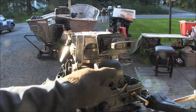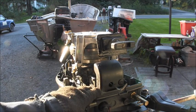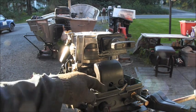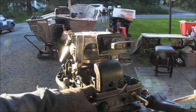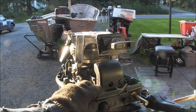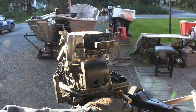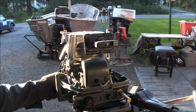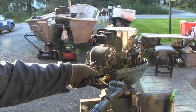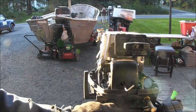But behind these rubber plugs that holds this to the carburetor are two screws. They will typically be Phillips head screws. And taking them out, if you drop them, they're just going to drop down into the bottom of this plastic air cylinder. But when you're going back up with them, a lot of times, if you drop them, they'll drop into that. But you then have to worry about all this linkage here. Now you got to take it all lift it up out of there, work with the throttle, because that's your choke. So that can become very bothersome.